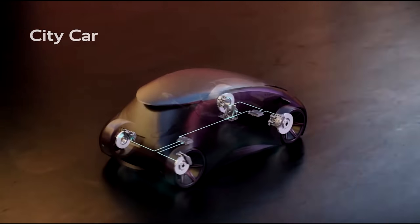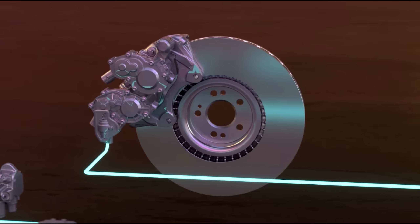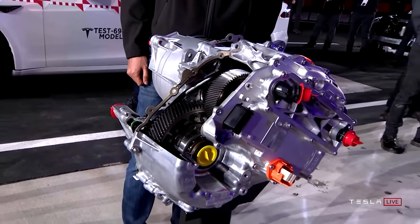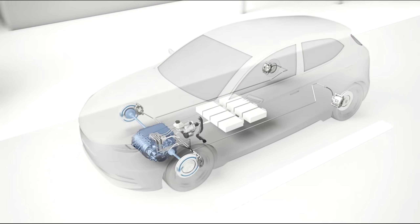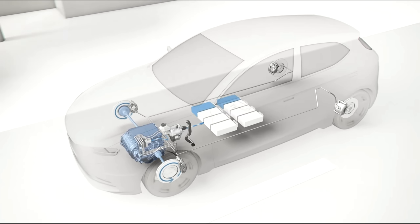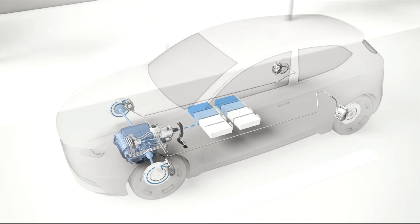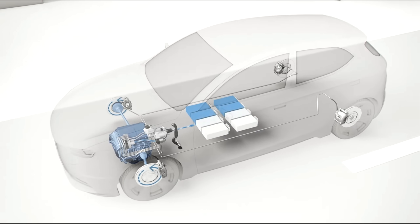What about redundancy? First, each brake could have two brake actuators or motors. And second, as Brian of Futuraza has pointed out, the electric motors serve as redundancy through regenerative braking. Yes, typically regenerative braking doesn't provide a huge amount of stopping power. However, in the event of a brake failure, the regen could be increased by increasing the power sent to the battery pack. That might cause some additional degradation, but safety is always the top priority.